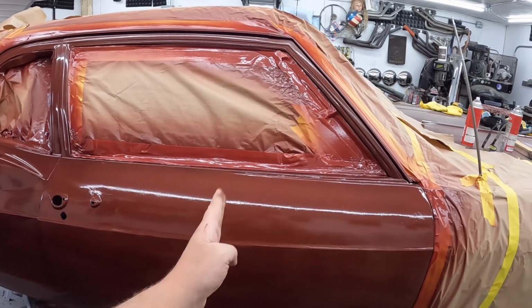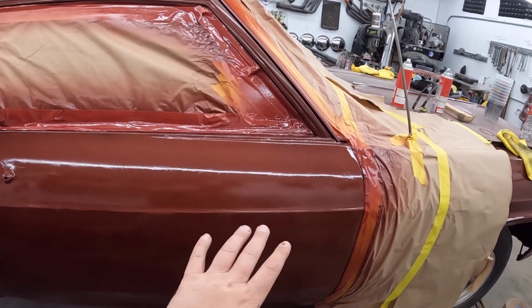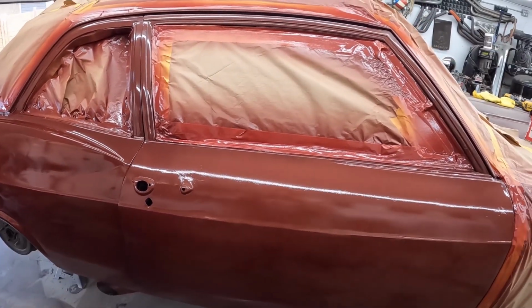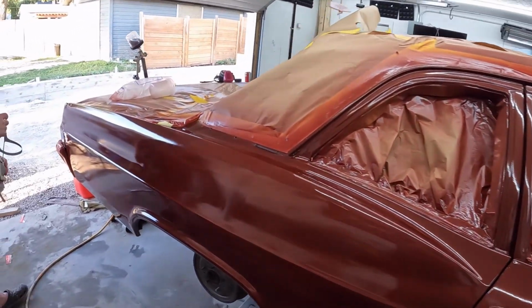so break it in thirds. So start in the middle of the door, go to the middle of the quarter panel, quarter to the end, and door to the front, middle of the door to the front. That will avoid kind of heavy areas with the paint, which I guess can lead to sagging and all sorts of runs and all that. So that's what Murr's going to do. It's a plan. So we'll get set up, put another coat on.